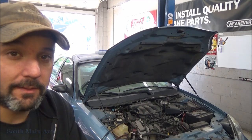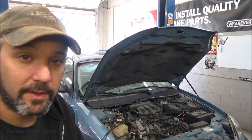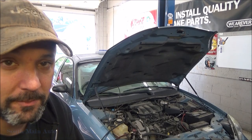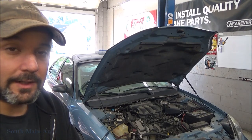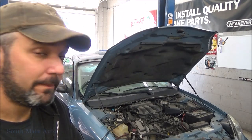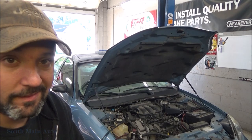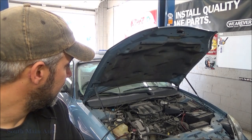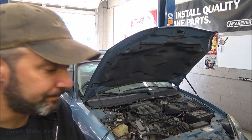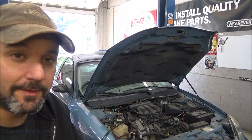So I told the lady bring it right down. Through the gauges on it here real quick so I kind of get an idea as to what we're going to be dealing with, whether it's an empty system or mechanical problem, electrical performance issue, whatever. Hooked the gauges up and it appeared to have a good static charge on it given the cold temperatures this morning. Reached in with the old screwdriver like we've done in other videos, hit the clutch, and there was some dust and dirt and squawking and stuff carrying on at first.